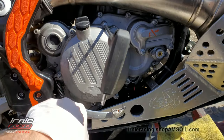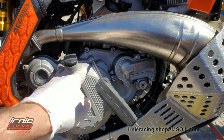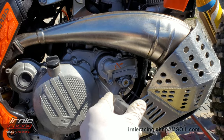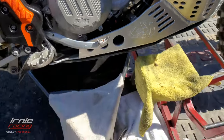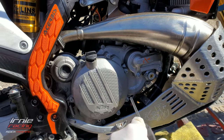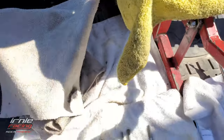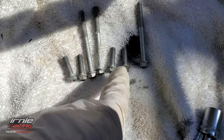It takes 0.85 quart. A little trick: I like to start at 12 o'clock and always go clockwise when removing bolts — 12 o'clock, then two, three, four, six, and around in the circle. Lay them down in order on a table, because in case there are different lengths you won't lose track. And sure enough, I got all the bolts out and they were different lengths — that's why the 12 o'clock method matters.